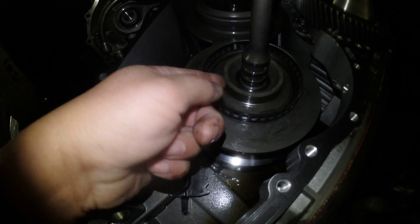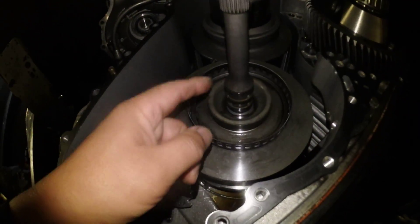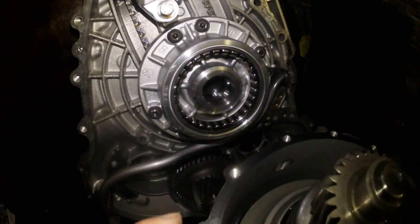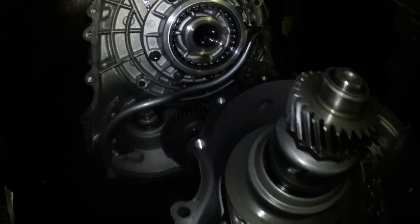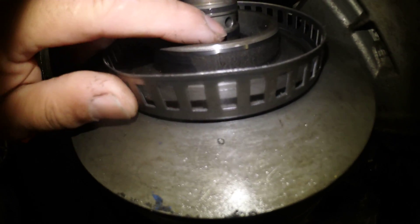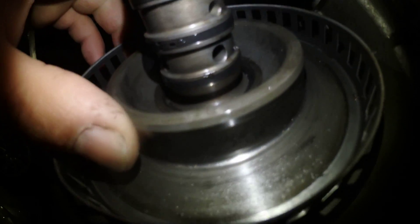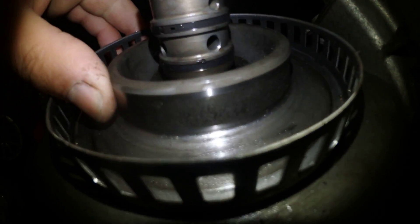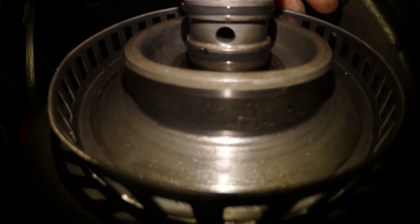The noise might also be coming from here on the shaft, not necessarily the bottom. If the noise is coming from here, the problem is not the bearing — it's probably the shaft itself. This shaft goes in through this bearing, and sometimes this surface where the bearing runs goes rough because the laminated part is damaged. You can see it here and that makes a horrible noise as well.